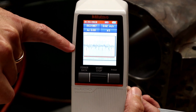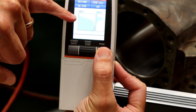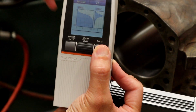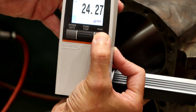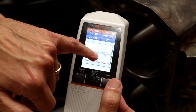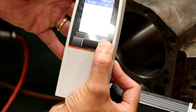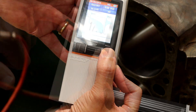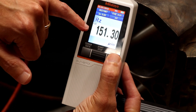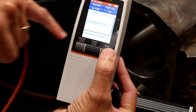This one's coming back as an RA of 17. You can see the peaks and the valleys — this is a pretty good looking profile. They call it a plateau type finish. This area up here is the peaks, which will rub off during break-in. Then there's the core roughness, and the valleys that are going to hold the oil for both ring seal and lubrication. The peaks wear off over time. That surface roughness would work with both a moly ring and a steel ring, and that RZ total peak-to-valley height is a good number — that'll get the job done.